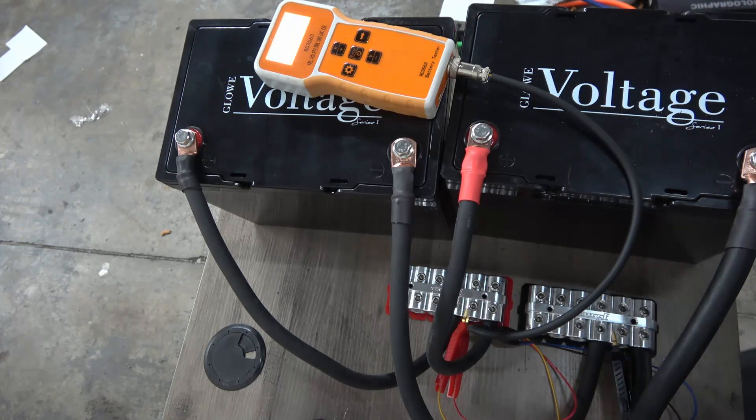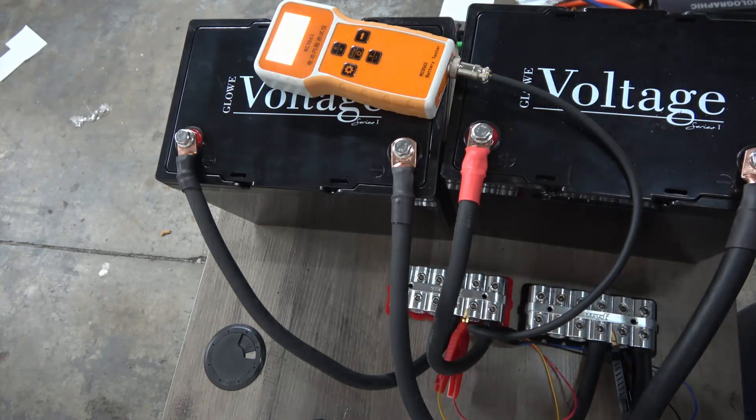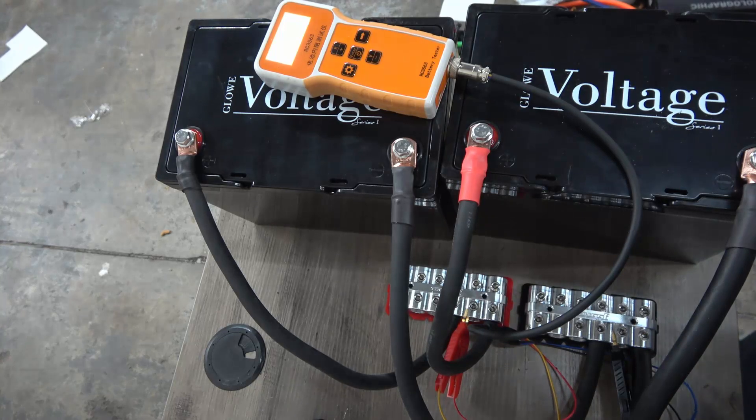But more importantly, when you're talking half a milli-ohm and you're only at 1.3 without it, you're over a 33% increase. So if you're looking at 1.8 and shaving 0.5 off that, you're going to get a lot more power out of the system and your voltage is going to keep up a lot better. So there you have it — it is 1.8 versus 1.3.